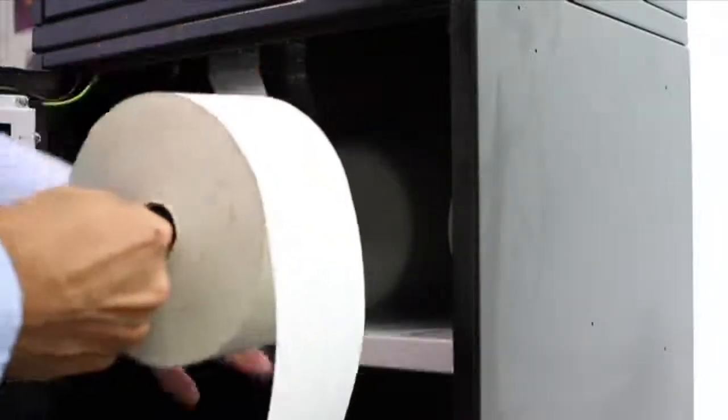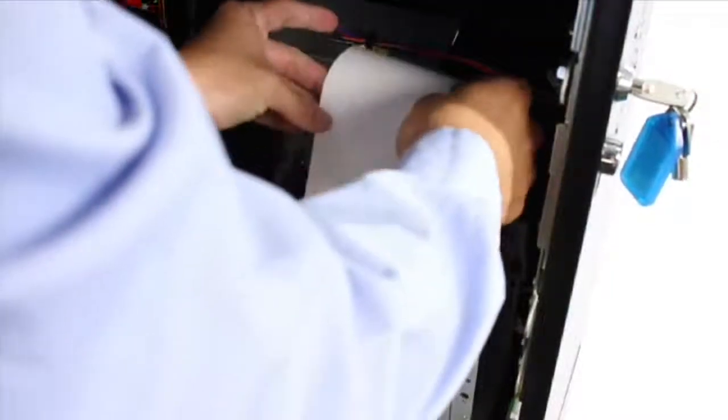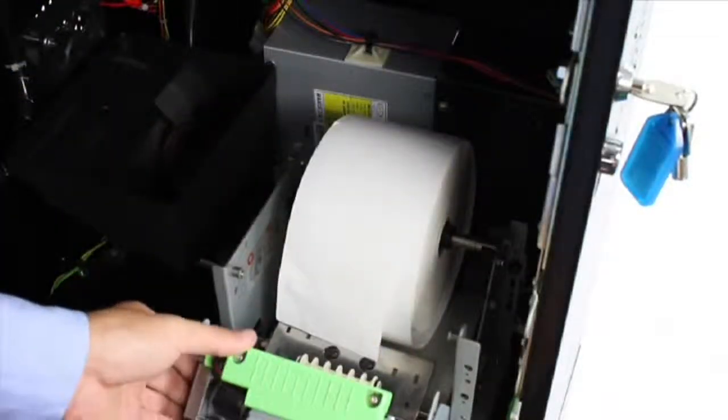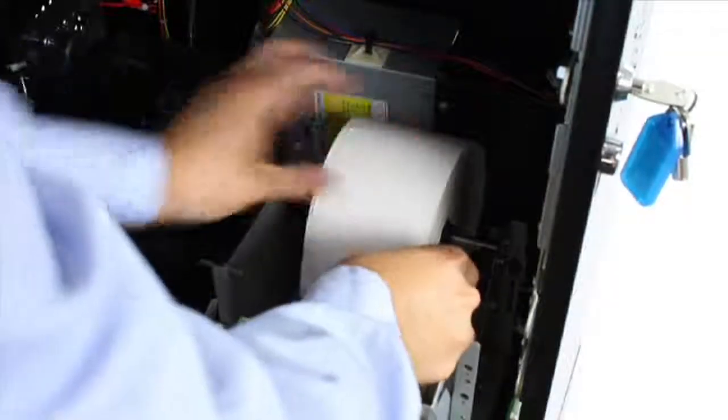Take one of these out and lock the base door. Now open the machine's main door using the second key, numbered N5008. The paper spool fits into the printer located here. Push down the lever on the bottom right of the printer. Now pull the printer housing like this. This lets you feed the paper through so that it's ready for printing.